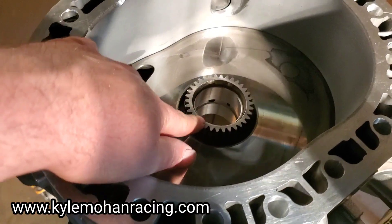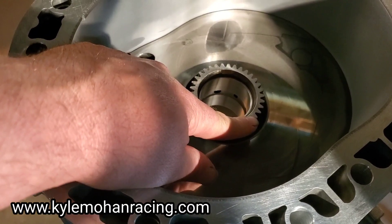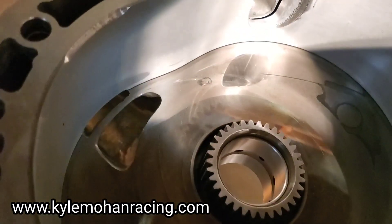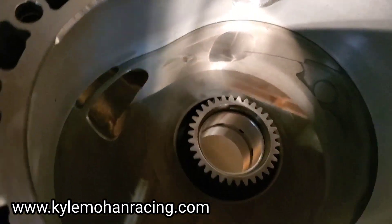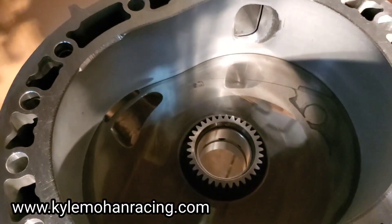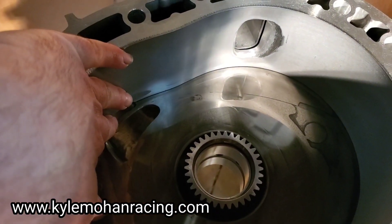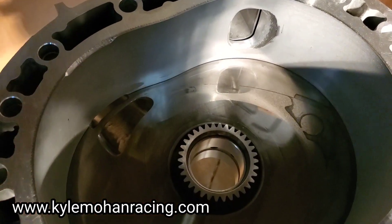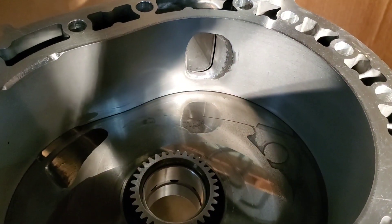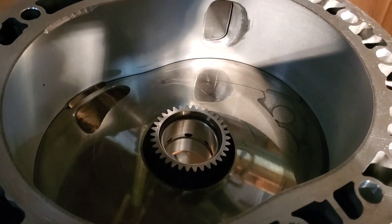You can see we've put in a brand new multi-window bearing. I also polished the top of this gear face. I like to remove the stress risers. Whoever did the porting — I think this came through DNA — they did a nice job and it's got really nice ramping to that bridge. One of the reasons I like the template we offer is it does not cut the water seal, so you get very aggressive opening timing. Sounds great, great horsepower, but you still get reliability. They did a very nice job on the exhaust porting. I think that's DNA, John Kepler — really good guys over there.